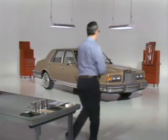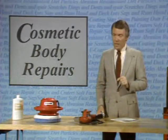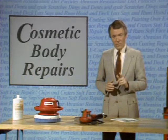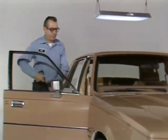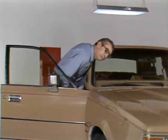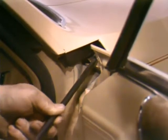The first step is to find the best access to the area of the dent, and then to decide which tool would be the best to use from that access point. Not all dents will be accessible — if there is any question, check the parts or collision books for internal structure. For example, this dent in the catwalk of this car is toward the back half of the fender, so the technician gains access by opening the door and sliding the body rod in over the top of the upper hinge. This allows him to reach the area under the dent with the rounded end of the rod and to use the hinge as a fulcrum point to apply pressure against the metal. With the rod in position, he begins to apply pressure gently around the edges of the dent, pushing only as hard as necessary to cause the metal to lift back up into place, slowly working into the center of the depressed area until the surface is smooth and even again.